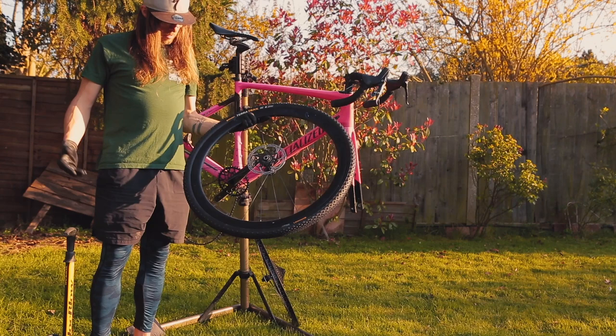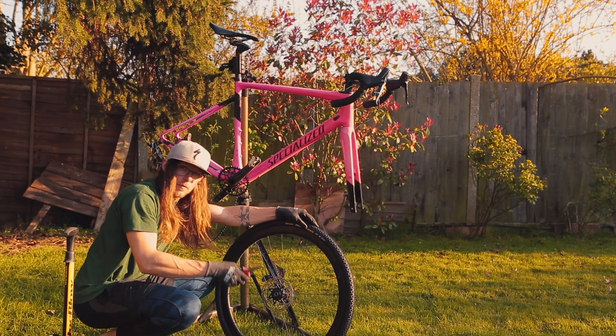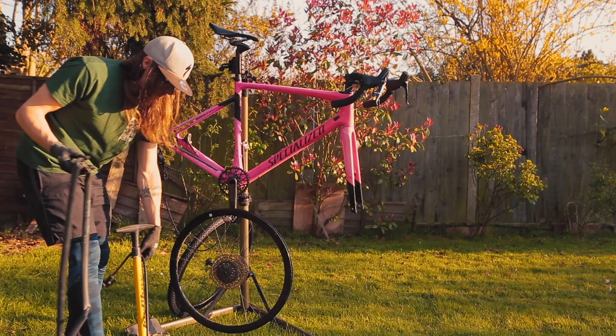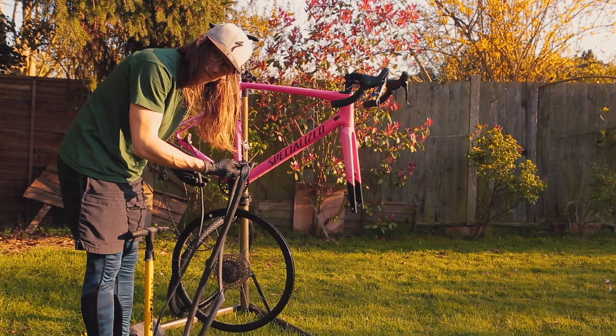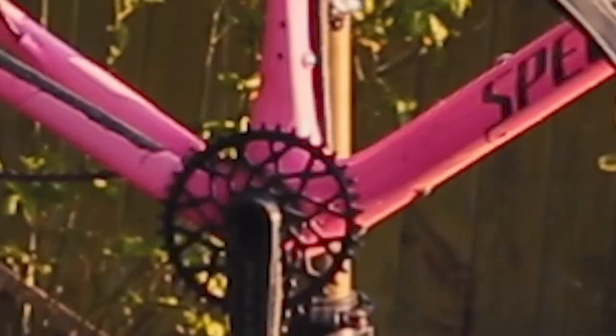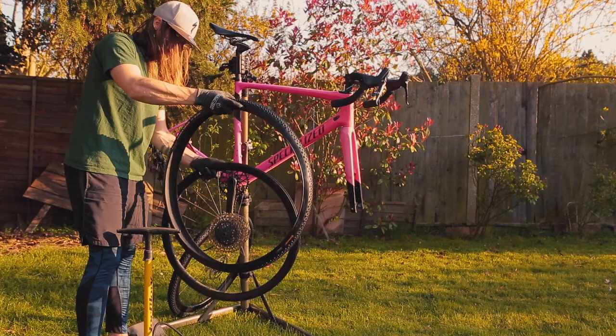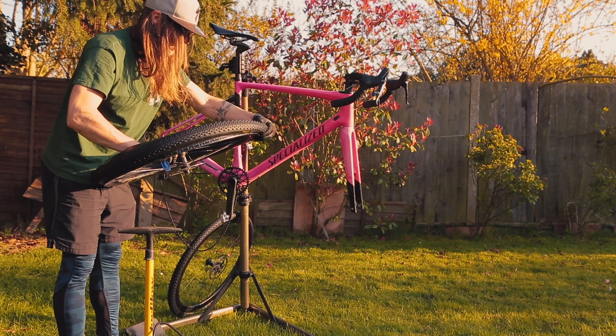It went so much smoother than I expected. Obviously it's up to you whether you want to wear flip-flops and leggings when doing it. To recap: make sure your valve stem on the tube is long enough for your rim. Always check the rotational direction of your tire as well. Get the logo above the valve — five extra cool points right there.